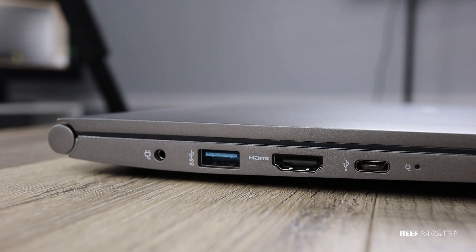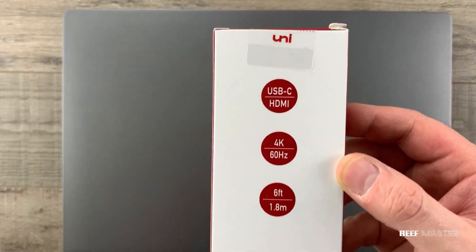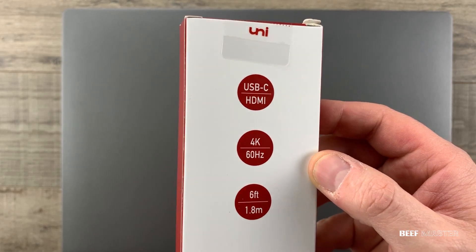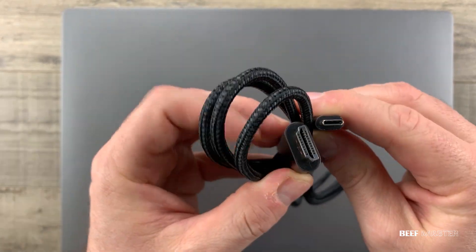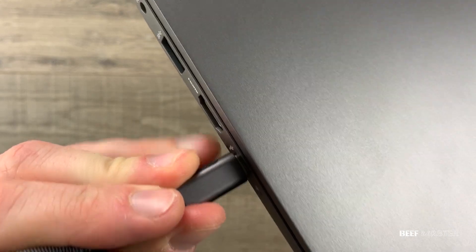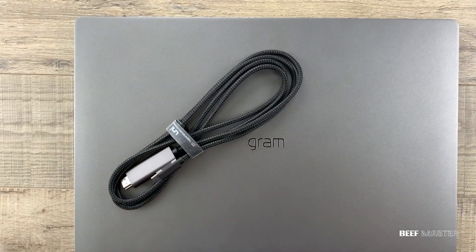The first item I recommend is this USB-C to HDMI cable from Uni. You'll want to get a cable like this as it will output in 4K 60Hz. A lot of times HDMI cables will only output in 4K at 30Hz, making movement lag. One side of the cable is USB-C, the other is HDMI. To use this, plug the USB-C end into the computer and the HDMI into your monitor or TV. Getting 60 frames a second makes your monitor much smoother and using a mouse much easier.